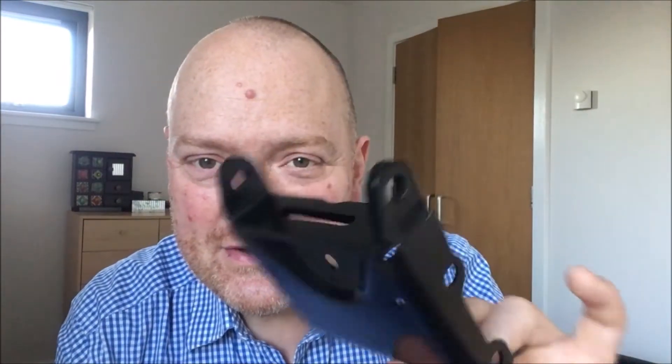So here we have one shiny new stand bracket. And the one I have has cracked right down here, which is obviously going to cause movement so the stand isn't as stable. So what we're going to do now is go down to the bike, take off the old one. I think it's just four bolts to either side to take it off. Have a look at the stand itself, probably give it a clean down, a lick of paint. I've got some direct to rust Hammerite paint, black paint, and it'll do the job.